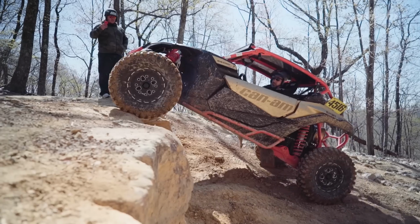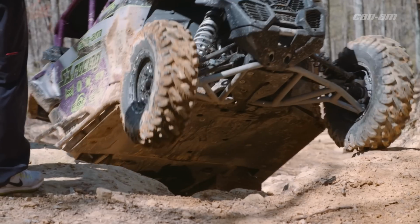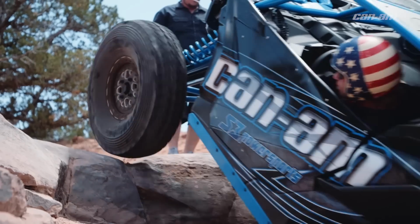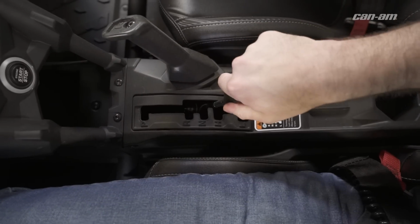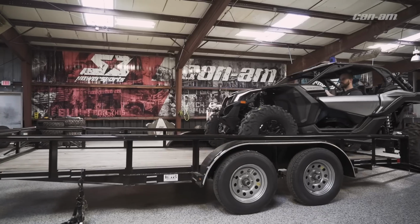My personal preference is if I'm going under 15 miles per hour, I'm gonna be in low. The clutches are pinching onto the belt, you're getting good pull, that's what's gonna save your belt. Another instance when you really need to be in low is when you're pulling it on the trailer. You're going slow, you need good belt pinch so you can pull it up onto the trailer, put it in low, 4-wheel drive maybe, pull up onto the trailer, park it, you're good to go.